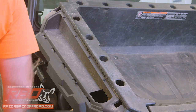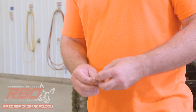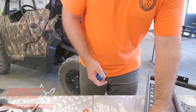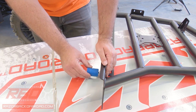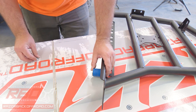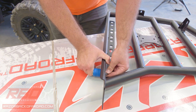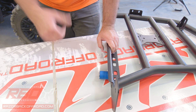Once you remove this bolt, put it off to the side and gently lift up the panel — it'll just pop off. This gives you nice access into the bed panel. Included in your hardware kit, you're going to want to grab the 5/16 bolt and the large washer. This is the anchoring system that holds the rack onto the bed. You're going to install one of these with the bolt, the washer, placed onto the forward-most hole on the rail of the side rack. Then take your anchor and place that on the bolt. The laser cut piece goes on first, and then the nut actually locks the rubber into place so it doesn't spin when you're tightening it down.